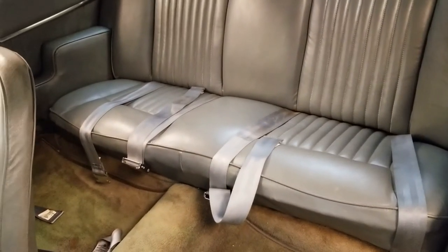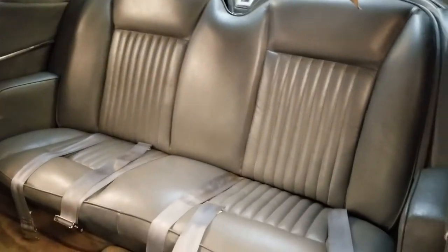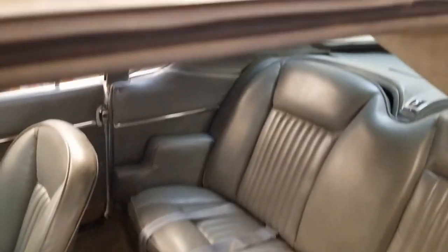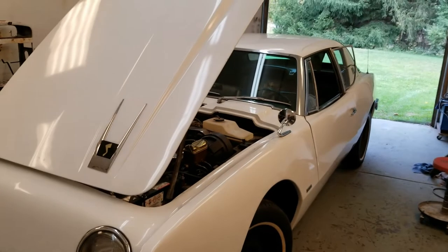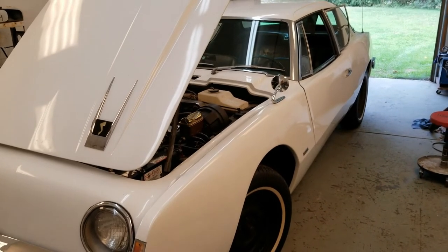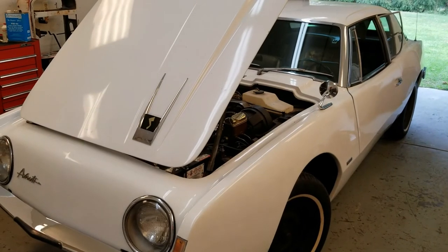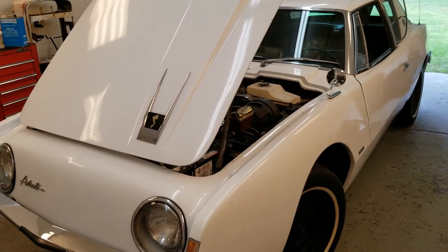Going to do a final clean up on the seat bottom and pop that in. Got the seat bottom cleaned up; I'll tidy up the seat belts — just a little dust on them. We got the seat in, so the gas tank job is officially done. I'll use a little leather cleaner on the side trim panels. I hooked up the main fuel line, blew out the fuel line to get all remaining fluid out, attached all the fuel lines, primed the carburetor with some fresh 93 octane, and put two gallons of premium in the tank — hopefully enough to get to the gas station.